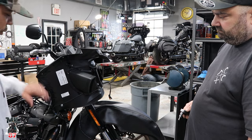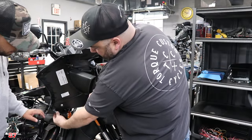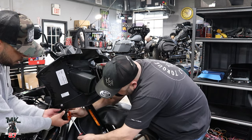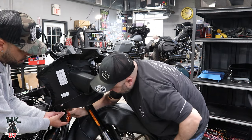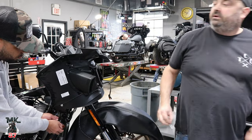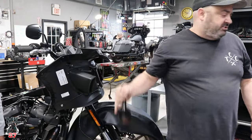We're going to start with the S1s first. First step is disconnecting the turn signals. Disconnect the wire right here, press the button, pull it apart. T40 Torx back here behind. On a scale of 1 through 10, how hard do you think this whole install could be for someone doing it at home in their garage? It should be pretty simple — I just need to look at the harness that they provided. For the average person doing it at home, as long as the harness is plug and play, it's going to be simple.